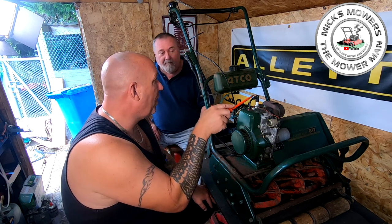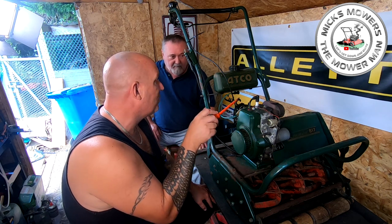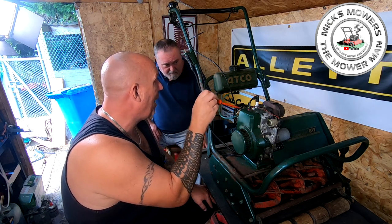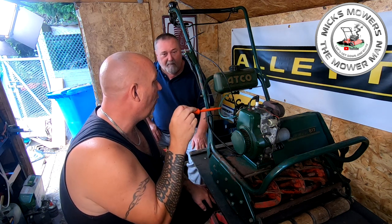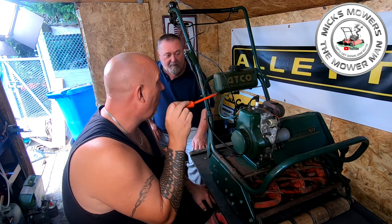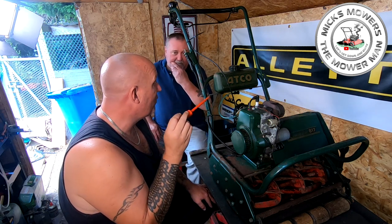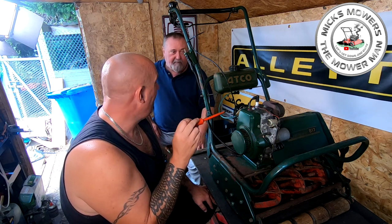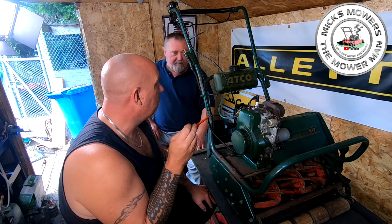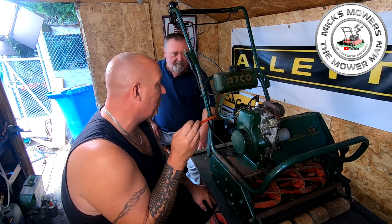Now this could have an adverse effect. You could find that your spark plug's getting very, very choked up very quick. And in fact, that's not actually the fault. I'm just allowing the machine to run better, but your spark plug may show a bit later on that you're having too much fuel. And your carburetor could be at fault. And you did say that your main jet was knackered and you have problems getting it out. So the carby could be on its way. It is a Mikuni carb. They're not the best carbs in the world.